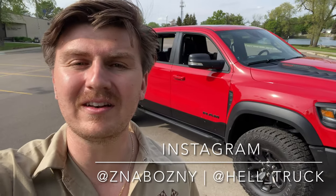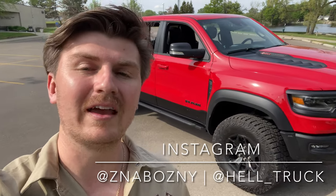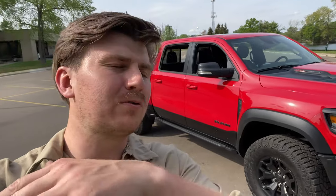It's a very big misconception that this truck has mufflers — it does not. It only has two resonators, one for each bank: left bank, right bank of the engine. And today we're going to be removing those. That means this truck will be straight piped from the converter — obviously back, got to meet EPA standards and emissions — but after that it is a straight pipe, straight to the exhaust tip.